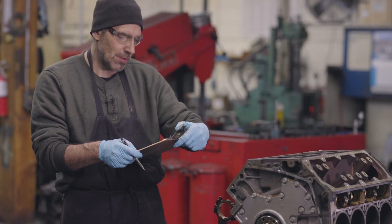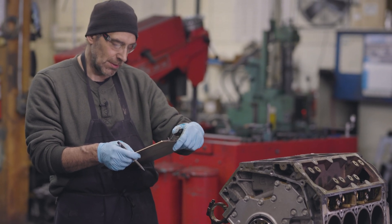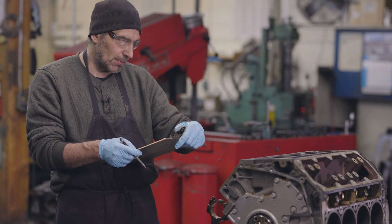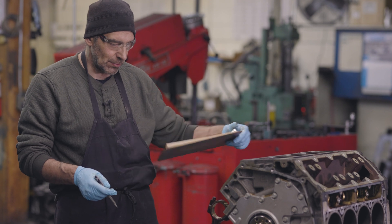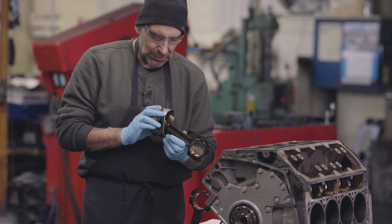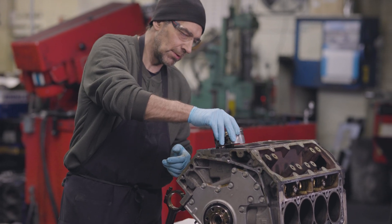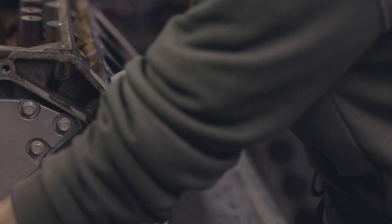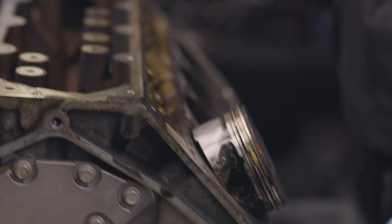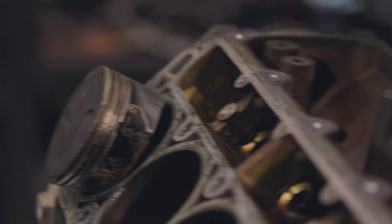The piston collapsed two thousandths of an inch. They're all the same size but only a thousandths of an inch collapsed. That makes sense with the wear that we see on the piston. That's the driver's side — oh, that one has much less wear than that one, and this whole bank is like that.